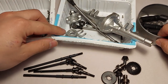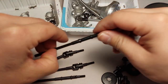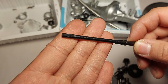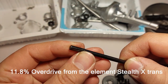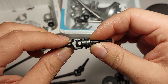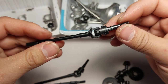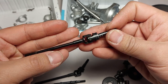Let's have a closer look at the actual gears in detail — here it is all torn down, and I'm happy to report everything looks pretty good. Starting with the axle shafts themselves: front and rear axle shafts pretty much look brand new. The steel quality is actually really good. You can see the wear where they connect to the locker is pretty much as good as new. The front obviously has a bit more stress since the vehicle is overdriven, but in terms of play, the pins feel really good — almost as good as new. I'm very impressed. These also fit stock axle housings; I've thrown them into a plastic axle housing and they definitely work.